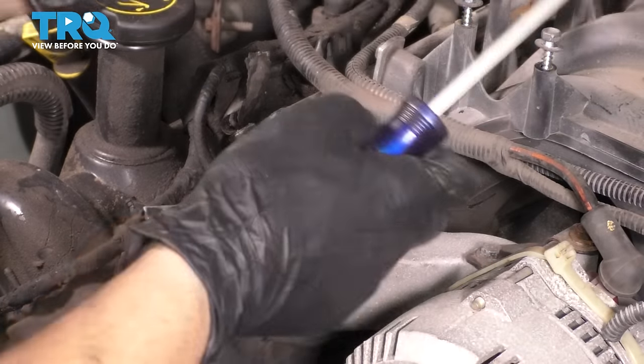Also, I should have mentioned, but before you put this on, obviously, when you clean and change the gasket on the cover, also clean the surface on the engine so that everything can be nice and clean and seals up properly. So let's run these down and press the cover up against the engine block. Actually, I'm gonna start a few more bolts because might as well. I'm gonna start all of these studs as well.